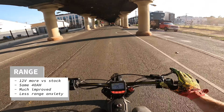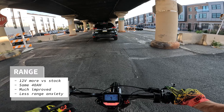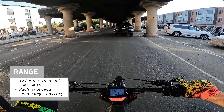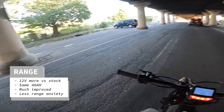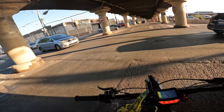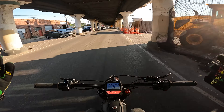The other thing to talk about is range. Since you have 12 more volts with the same amp hours, you're going to get better range. The caveat is if you're pulling maximum power output all the time, your range probably isn't going to be quite as good — maybe comparable to stock or even a little less if you're pulling 12-13 kilowatts non-stop. But I run mode one primarily, which is 8.5 kilowatts, and my range has been crazy. I haven't gotten it below 35%, even after four-hour stints.